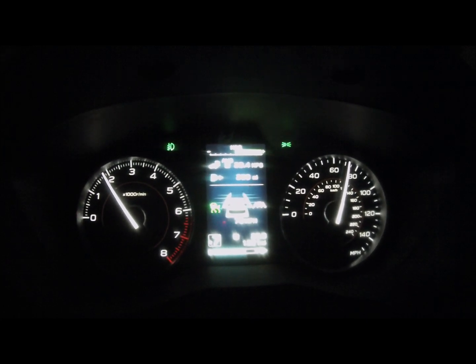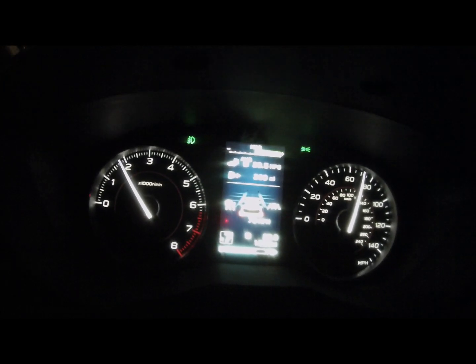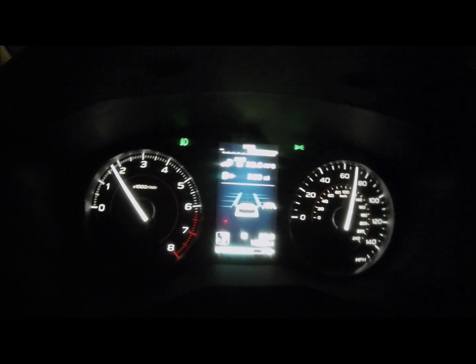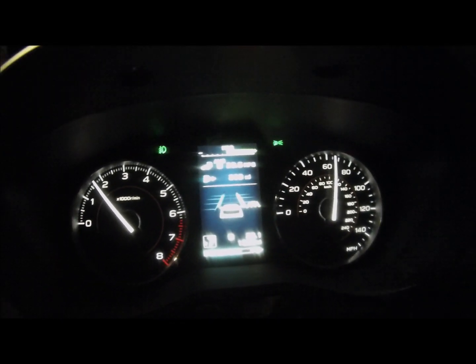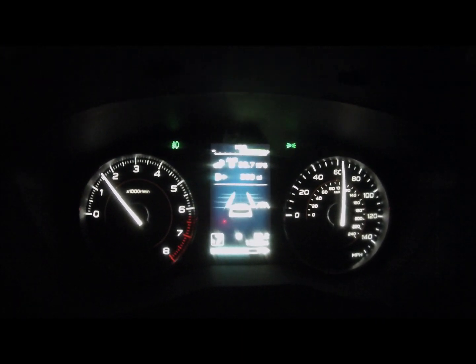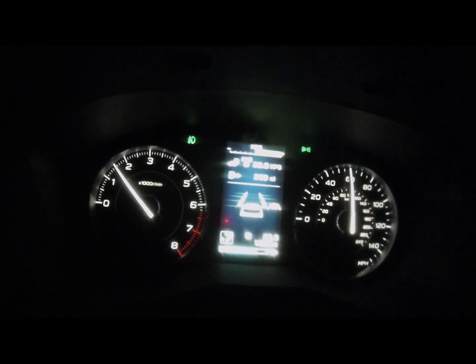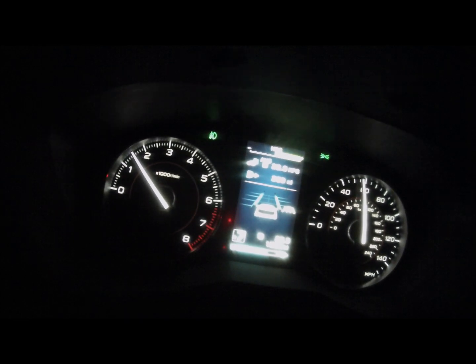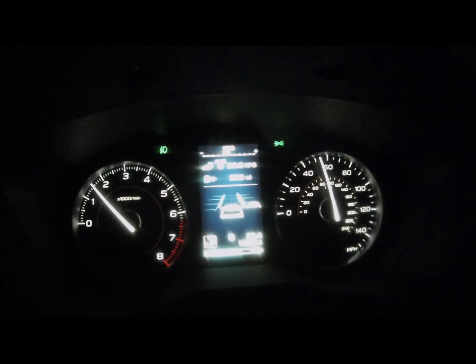So the reason why this car gets so much more power at 3,000 is that's where all the, I want to say, and I'll Google it later. Turn off cruise now. About to hit a turn. When I Google this, I'm pretty sure the peak torque, I believe, is 148 foot-pound, but I want to say it's like at 4,000 RPM. So this car has no power under 2,000 RPM, and that's why when we were going up that grade, the speed was dropping dramatically.